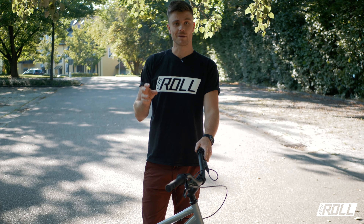For gearing on the 26", I've always run 22 to 18, and occasionally 22 to 17 if I need a bit more speed – but otherwise it's a great compromise. The saddle is a standard BMX model, but with Kevlar – I put a lot of value on that because the others rip relatively quickly. The seatpost is a Pivotal BMX model: very clean looking, only needs one bolt to secure the saddle instead of two like on mountain bikes.